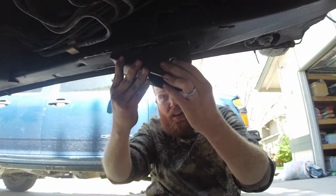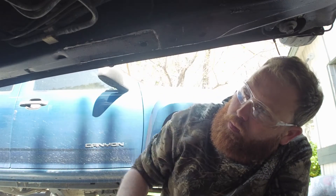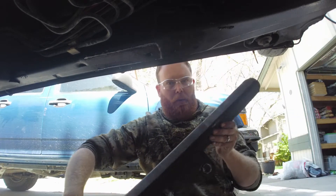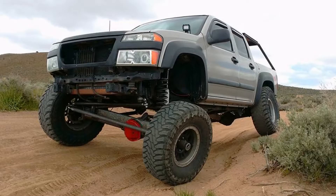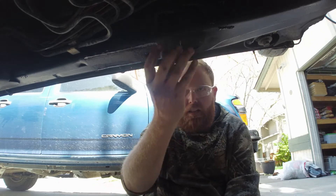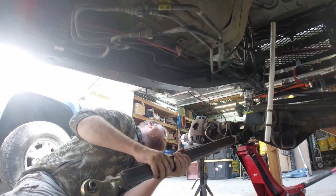Now technically that's got to be about there, give or take. I had to change blades — I couldn't quite get deep enough into the cut here to knock this back, but I got it pretty flush. I'll flush that later. I had issues with my 37s turning — you guys can see that shiny spot was where the 37-inch Toyos rubbed. It looked really good but the 37s just didn't appreciate it too much. So I know I need to move these inboard, and I think what I'm going to do is tighten this up, put this back on, and see kind of where everything lines up so I can get the link inboard so that my 40s can swing inboard a little better.